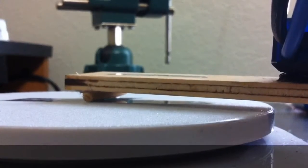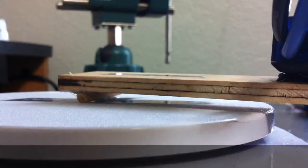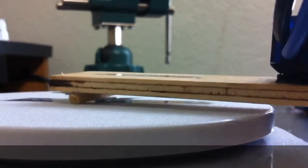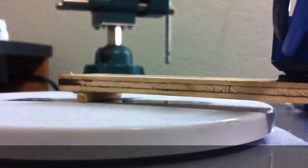The 6x4 will draw a fairly similar amount of power, slightly lower pitch speed, of course, because it's a four inch pitch, not a 5. But you will have tremendous thrust. So if you're not going for just speed, but just wanted to be able to climb indefinitely, and be easy to handle, this is probably the prop that you're going to want. As you can see, 17 amps there, and oodles of grams of thrust.